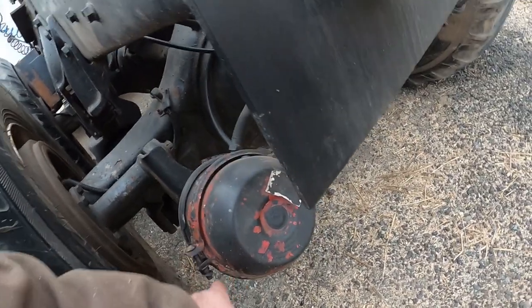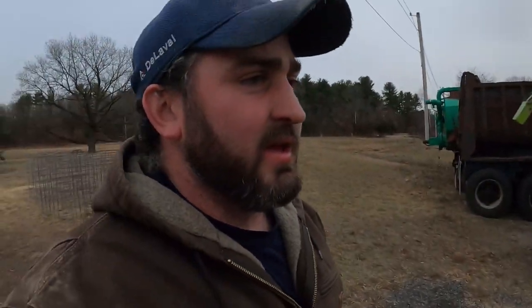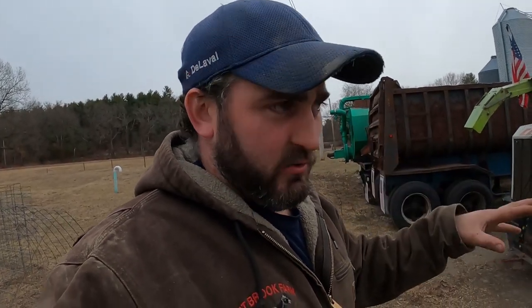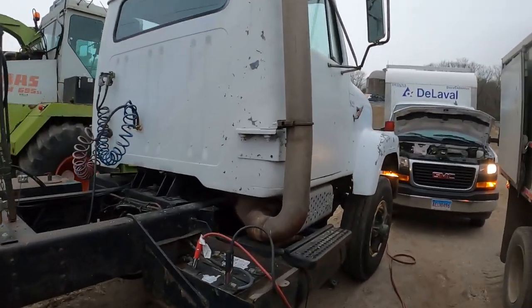So that's why they went to brake cans that aren't serviceable — this top doesn't have a ring you can remove, whereas the old style you can take apart and potentially have it explode on you. I changed the two fronts with a spare I had. I stopped and got another one today since I want this thing ready to go. Alternator charging, transmission crankcase pressure, and brakes — that's it for this truck, and then I'll be really happy with it.